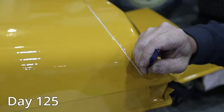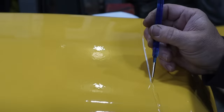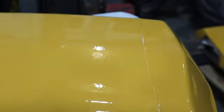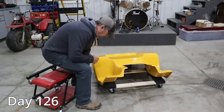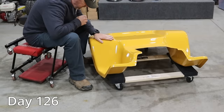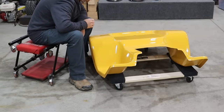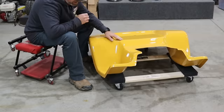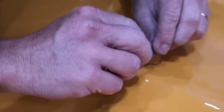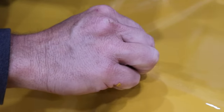It's day 125. I'm going to see if I can touch up this little patch job I did on the seam in the hood and just use a fine little brush to put a little color on there. It's day 126 — this thing is shiny and it would have been really good had it not orange-peeled up so bad, and I have a few sags to correct. I'm going to work on this a little bit with my razor blade trick, then wet sand it out.